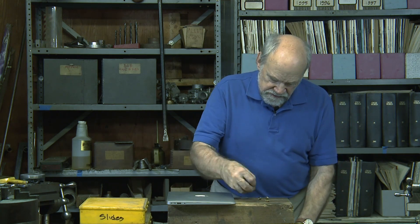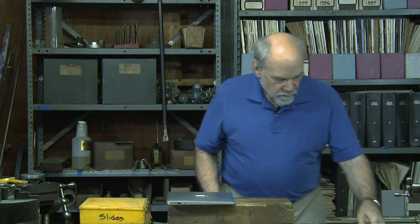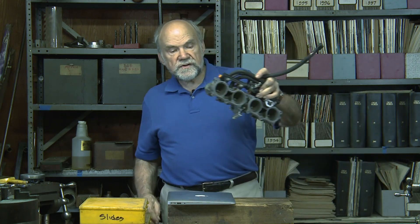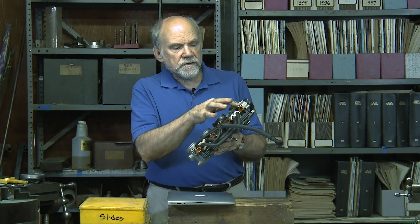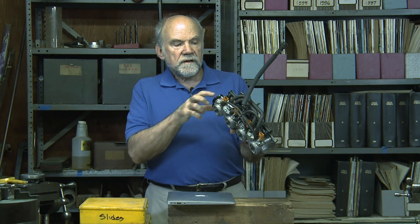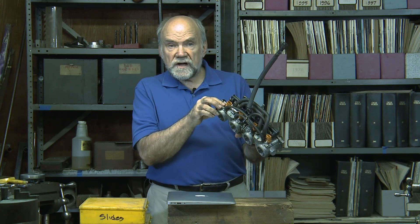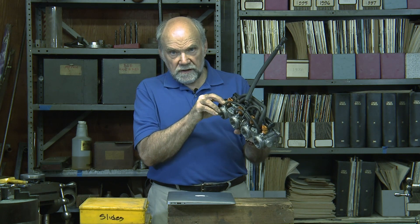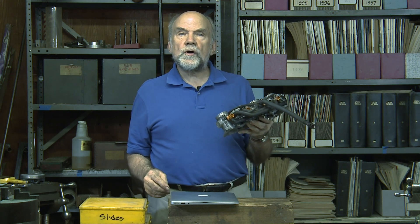On the other hand, we can set this material aside and substitute fuel injection. These four orange jobs are the electrical connectors that connect the wire harness to the fuel injectors. The fuel injector doesn't have any tapers, it doesn't have any little numbers on it — it's just a valve. It's either open or it's closed. The computer tells the fuel injector how long to stay open.